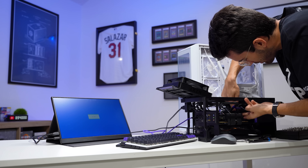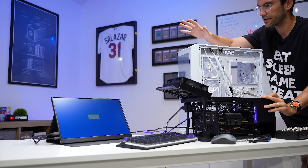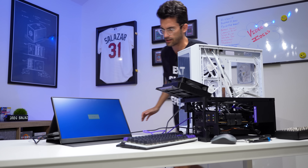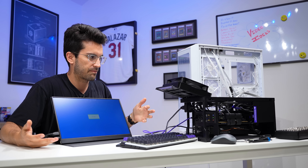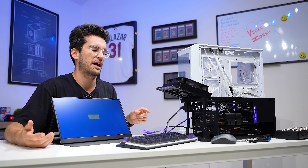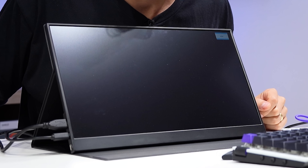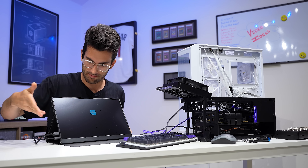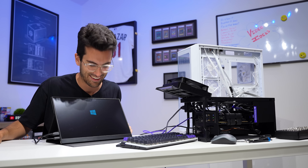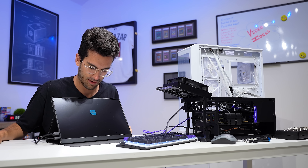Now it's looking a bit jank up here right now. We are just set up temporarily. It's connected to this case's Type-C port now. We'll power on. So essentially one of two things is going to happen here. Either the system loads into Windows, no problem — which would mean that the motherboard is fine and it's the case's cable that's bad — or we get the same overcurrent warning, which would mean that the motherboard's connector, the header, is bad. Wow. It didn't even throw up a splash page. It just loaded straight into Windows. That is interesting.